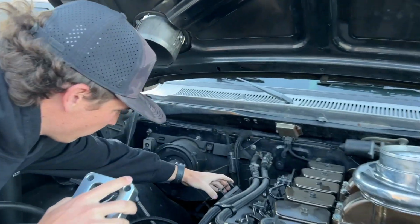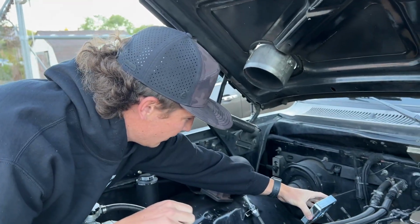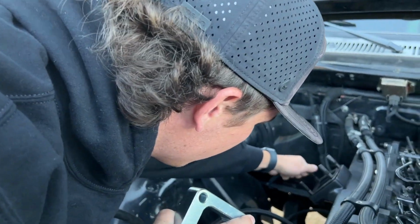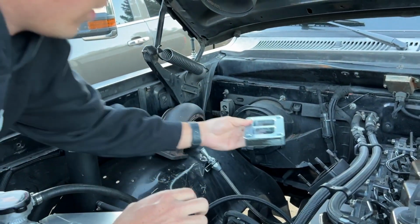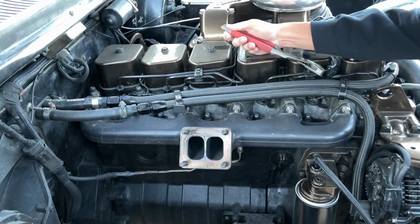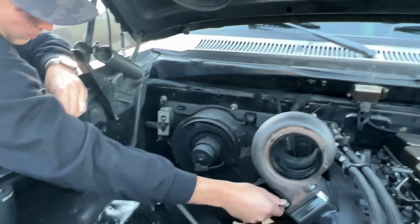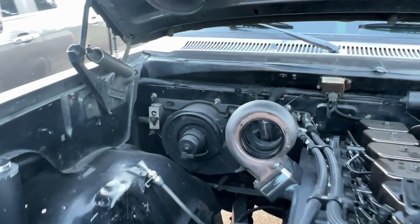Half inch spacer, 1 inch. I think maybe if we just loosen these studs a little bit. Yeah, I wouldn't loosen them too much. Just to, you know, that way we might not even need to. We'll put your spacer on there and see what it looks like. I think those ones are a little tight. So you're thinking if we just unscrewed them a couple threads and put the spacer on, there'd be enough there for a nut to get a hold of? Just enough engagement should do the trick.